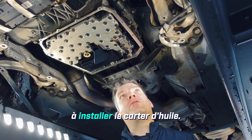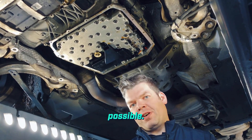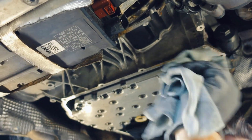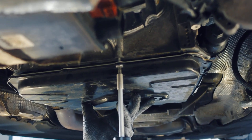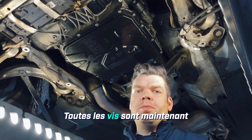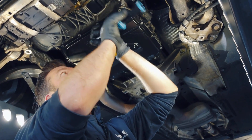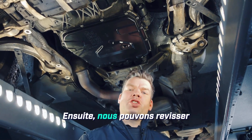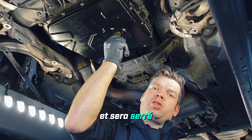As the next step, we can now install the oil pan. But before we do that, we need to properly clean the sealing surface — it should be as grease-free as possible. All the screws are now in place on the oil pan; we will now securely tighten them in a criss-cross pattern with 10 Nm per screw. As the next step, we can now screw in the drain plug again. It is fitted with a new sealing ring and will be tightened with 45 Nm.